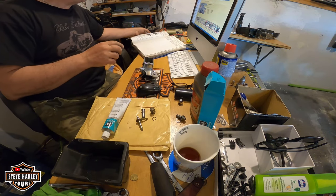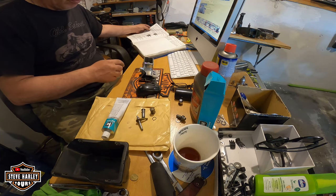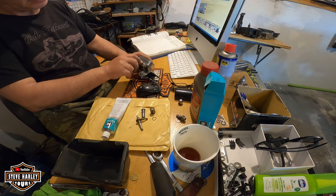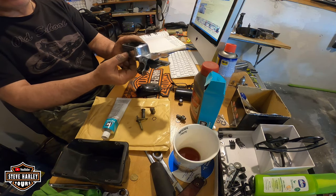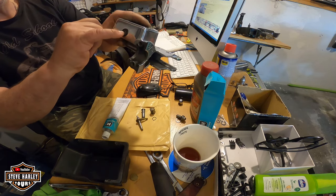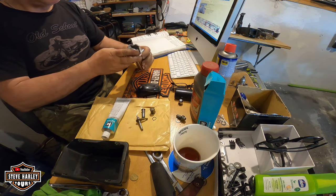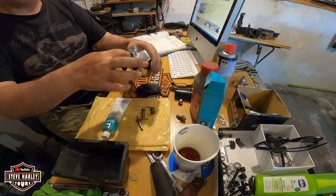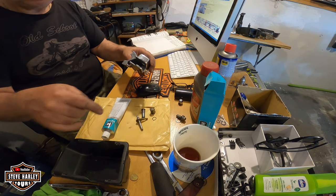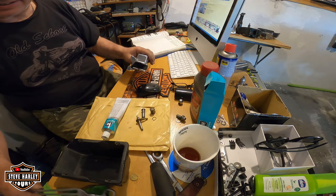Okay, it says here lubricate grommet, this grommet number 12 with brake fluid. I did that, just spit on it and I just put it back. It's not easy, but if you put the grommet first and then the little glass thing here, it's easier. Okay, this one I'm talking about. Okay, again, to put this back, the dust boot, and compress everything, I use the handle, okay, and I press it like that, and it stays inside.